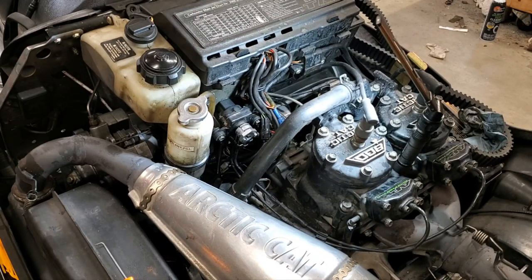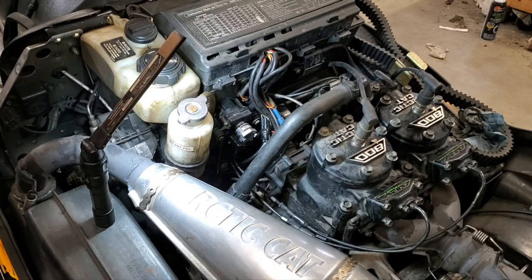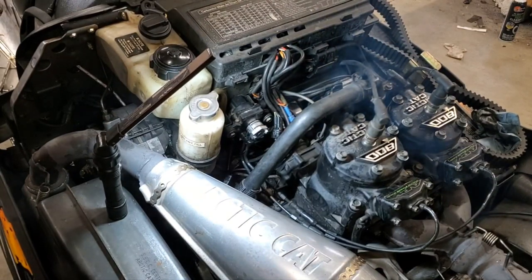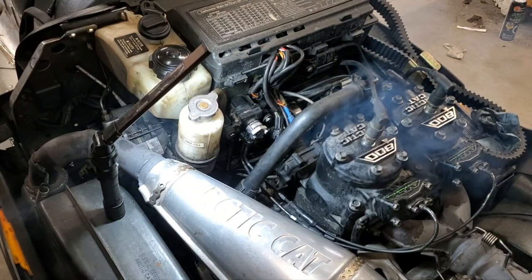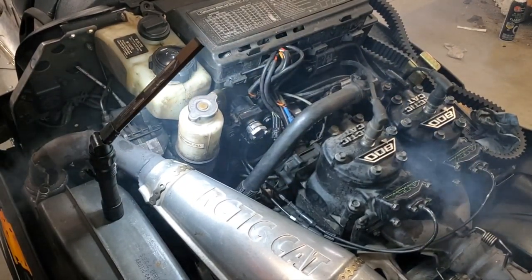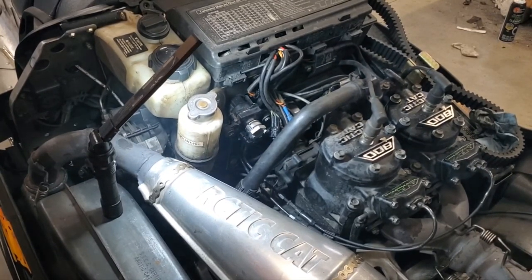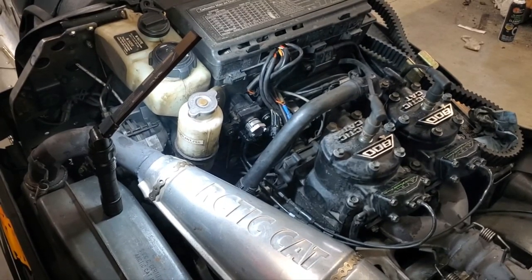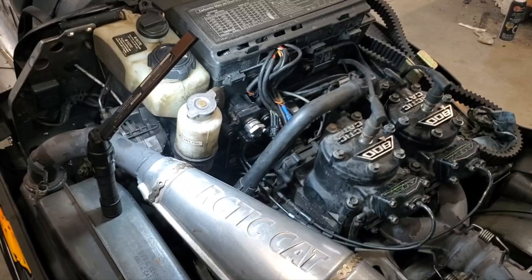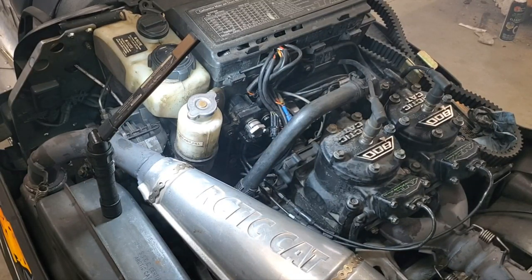choke on, make sure nothing loose is flopping around. Hopefully my light stays where it's at, but see if we can get it on something a little bit more solid here. Here, we'll put it on the exhaust. And hopefully we can see what's going on. All right, we'll give her a pull. Okay, hopefully you saw that, but it looks like the power valves are working as they're supposed to. I'm gonna go ahead and get this place aired out because she's all smoky, and I'll bring you back.